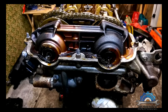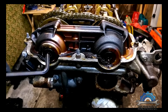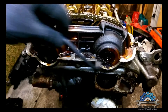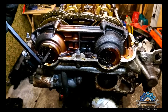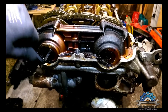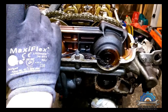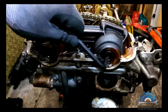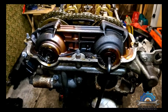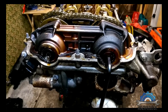VANOS removal. Before you start removing your VANOS, starting with these nuts, you have to remove these two cups. You need the Allen key — I sprayed some penetration fluid before. You'll probably also need a hammer, but I'm going to try to do it by hand. Be ready because there is going to be some spillage, so prepare yourself.